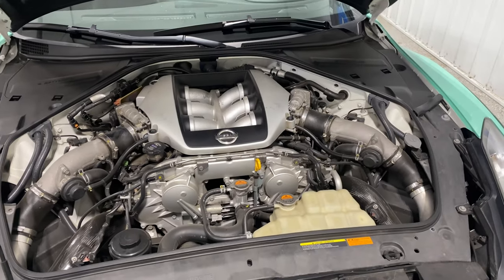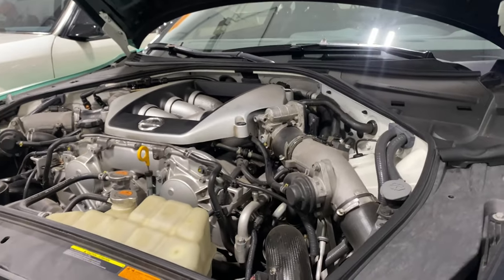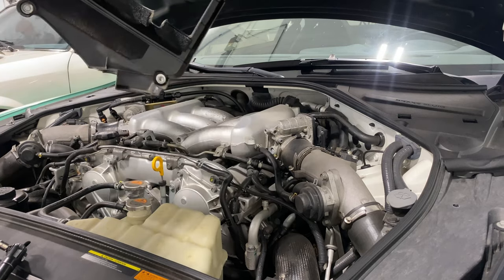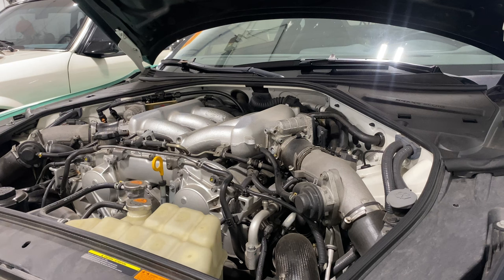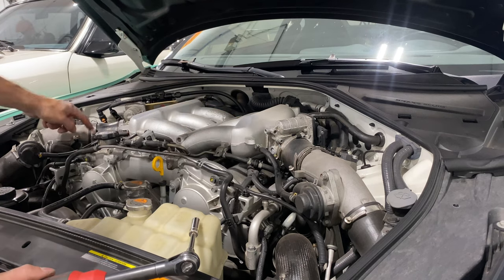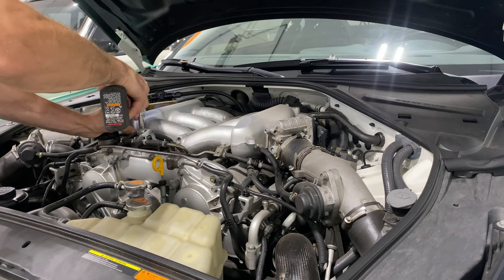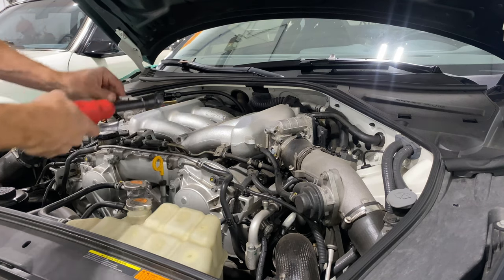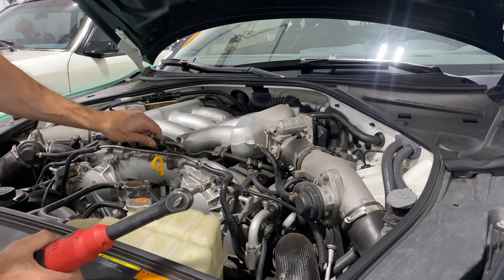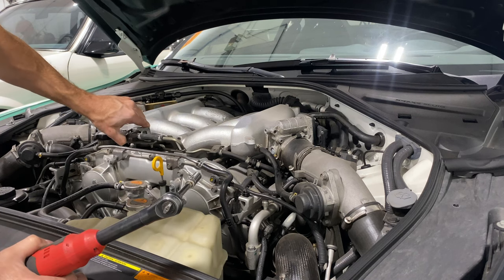Here's a little before — it looks just like an Ultima in my opinion. I already took the bolts out for that plastic cover, so I'll just lift it off. It's just four allen heads in the four corners, just a plastic cover. We'll set that aside because I think I'm going to paint something on there also. I already loosened the hose clamps on the boots — that's just a flathead. Now I'm going to take the 10 millimeter bolts out for the brackets. Looks like they're for vacuum lines. Not much room.